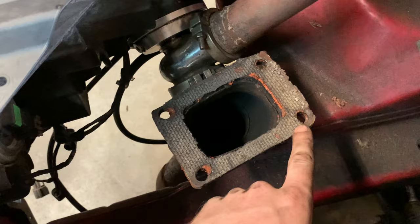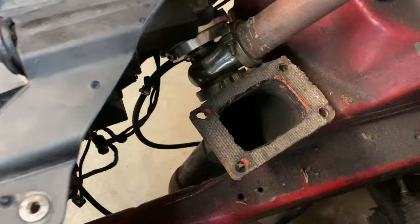Sometimes I find it hard to talk myself into doing it the long way, but when I do, I never regret it. Now I got the turbo, which I don't have a gasket for, but there is some residual leftover stuff here. I'm going to bury that in Ultra Copper. Of course, you can see some of that here. I'll bury both sides and squash it down, and then pray that none of it goes through the intake and destroys the whole engine. It won't, because it's on the exhaust side. There's like no downside to that.